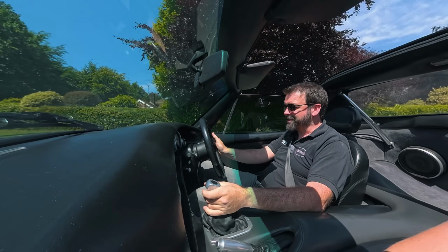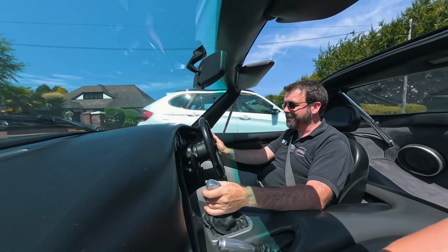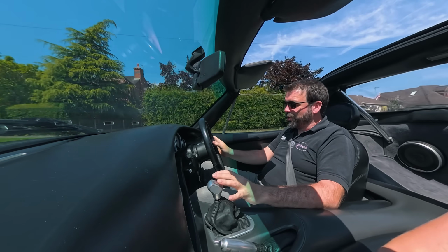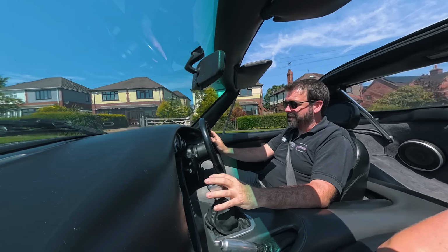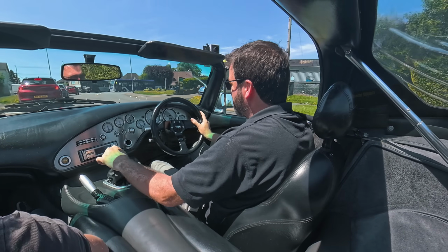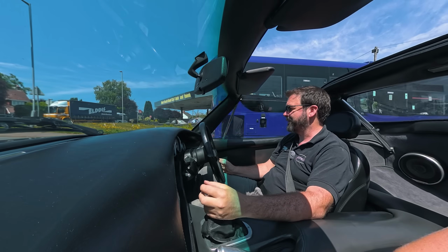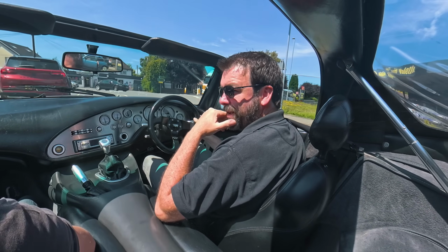And John, the guy that runs that, is a bit of a genius. So he's worked at all the major names. And when we first did the first chassis, we took it to him, and he measured all the motion ratios of the wishbones and worked out the right damper rates and spring rates for us. And he even said you've tuned out all the roll, so he went slightly softer to actually put a little bit of roll back in, so that your average driver can feel what the car is doing.